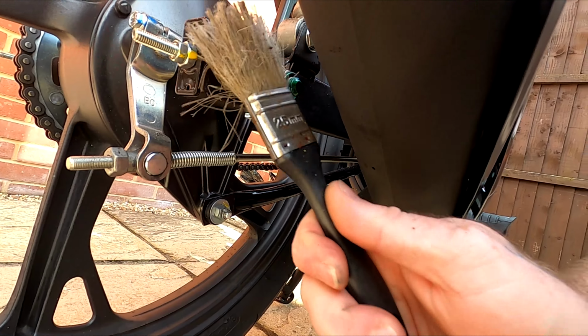Grab your silicone spray and cover the engine, frame, underside, swing arm, springs and all the areas as shown. You must avoid the tyres and brake discs. Spraying the engine is okay, some will burn off but the rest will settle and leave a water repellent barrier.